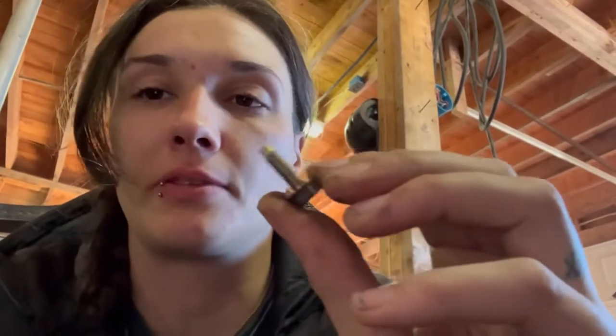I pulled the pulley off, and I don't think I needed a puller, period. It wasn't the correct puller for this job anyways, but I missed a part of the instructions, or I misread it. Either way, I messed up. All I had to do was take out 6 of these bolts from the pulley, and I think it would have just come off, because I pulled it off without taking these out. The sprocket on the camshaft came with it.